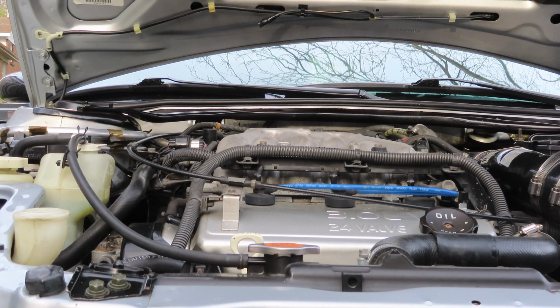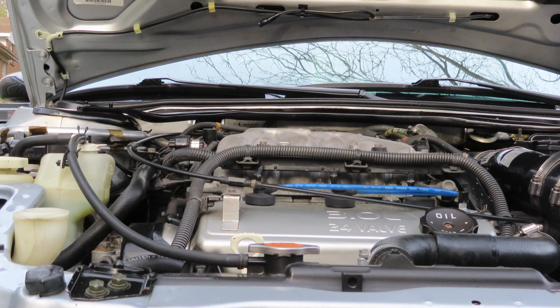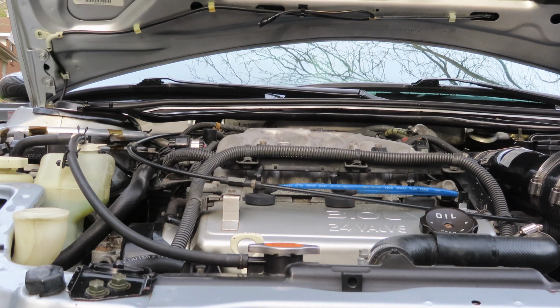From the top, the clean oil is sent through the entire engine through a circuit of oilways. It's going everywhere in your motor, lubricating every moving part that needs to be lubricated. These channels take the oil to the critical engine parts using pressure and gravity. The bearings support the crankshaft on a continuous film of oil. Pistons are cooled down and kept clean by the oil's detergent action. Your valve train is protected by the oil's anti-wear system. To avoid friction and damaging wear to these components, they must be well lubricated, which is essentially the job of the oil. The oil is the only thing preventing metal-on-metal contact.